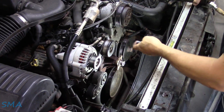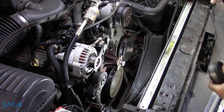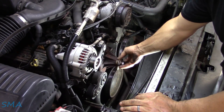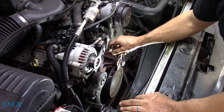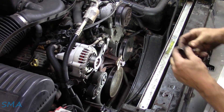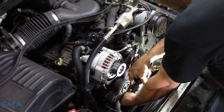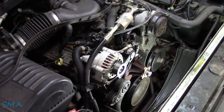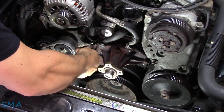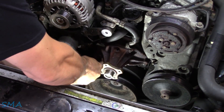First try. I want to remove the pulley just so we can see a little bit better — I know you guys have got a crappy angle, trying to make it less crappy. Plus we need to be able to see these two hose connections here. Now I've got a bucket under there. I believe most of the coolant is out of this thing. We're just going to cut the lower hose loose — the bypass hose and the heater hose there. And I think there's four bolts that hold this thing down. Then the hose will be stuck — see if we can't pick on it a little bit here. She's still got some fluid in her.